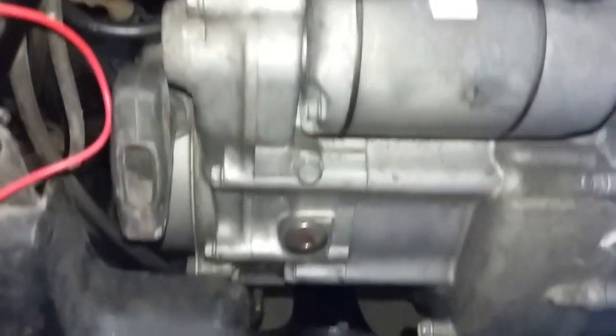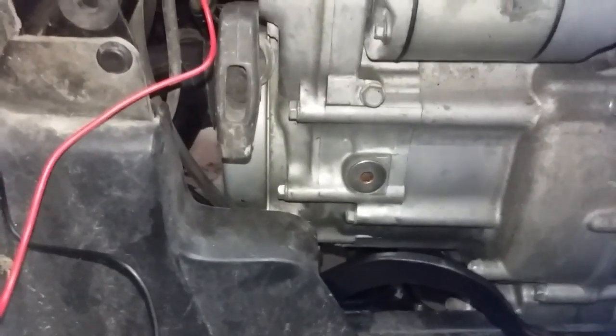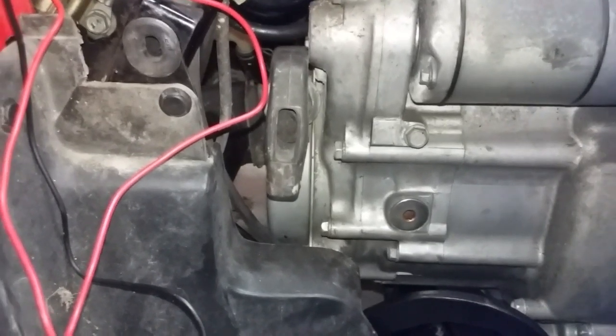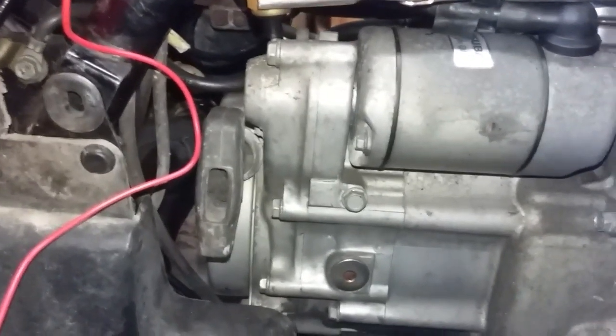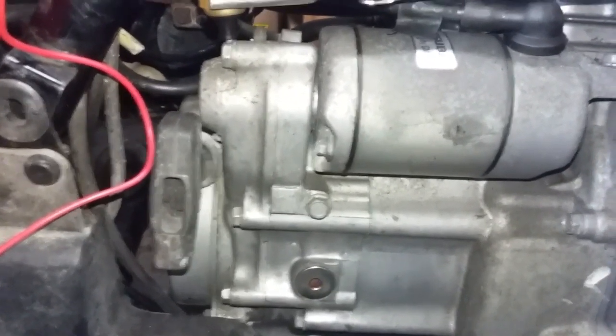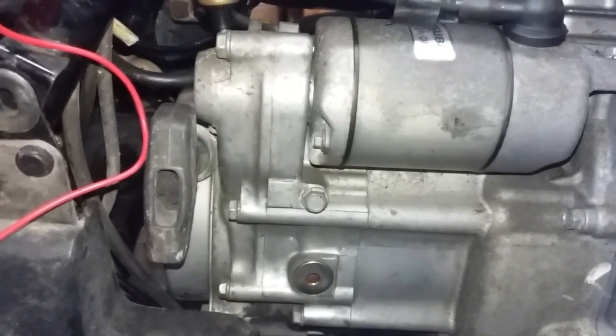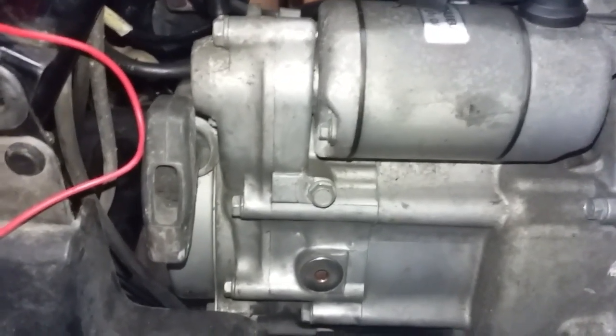So we know that the system works other than the temp sensor down there — that's what I found was the problem. The easiest way to complete the whole circuit is by disconnecting that wire and putting it to ground. If the fan kicks on, then you have a really good idea that the rest of the system is good. If you were to jump that to ground and nothing happens, then you're going to have to start isolating it — whether it's the fan, a broken wire, bad connection, the fan control module, something along those lines.